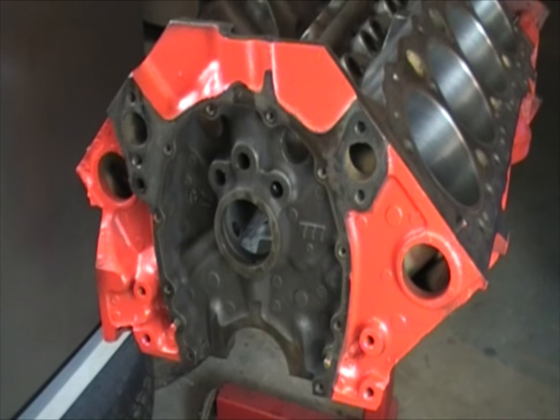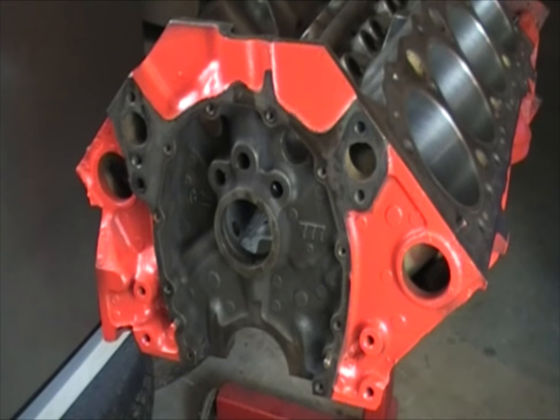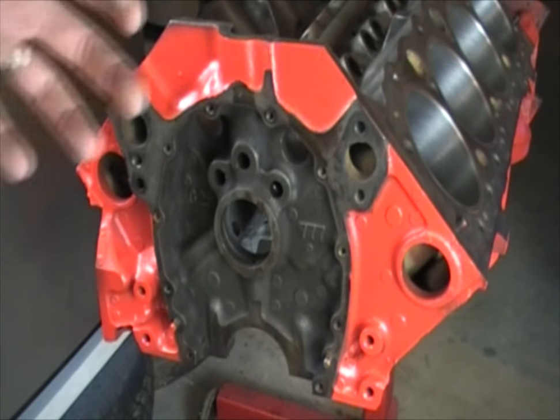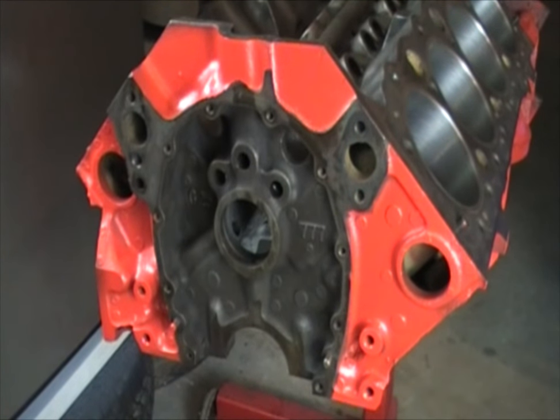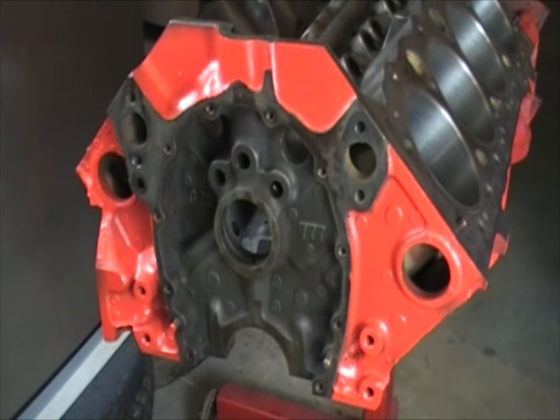I stand corrected — I don't use gasket maker on these three freeze plugs either. They're actually called oil galley plugs, and they keep the oil in there to build pressure. The way you remove these is they're caps that go in there, but to remove them you have to remove three threaded bolts on the other side. Then you shove a rod through each of the little lines that run through to pop these three out. You want to remove these if you're going to have your engine tanked — otherwise it won't clean everything out, which is a really crucial part.